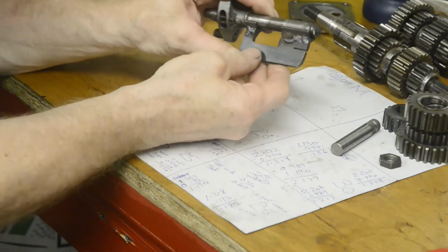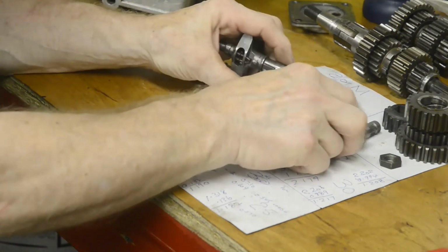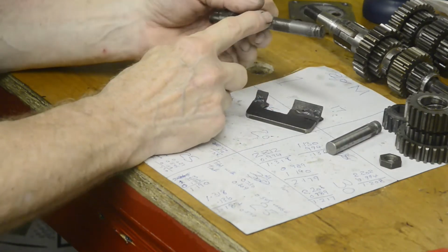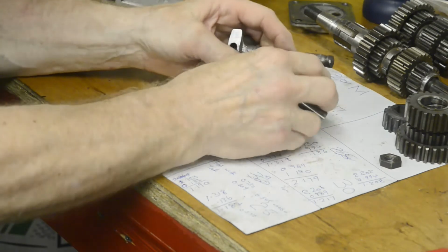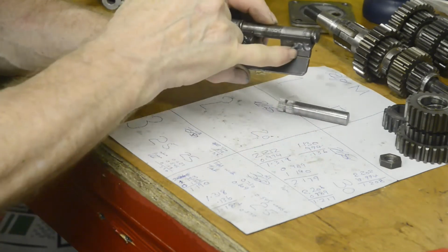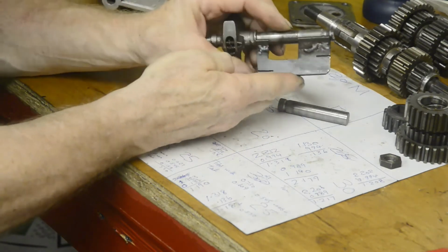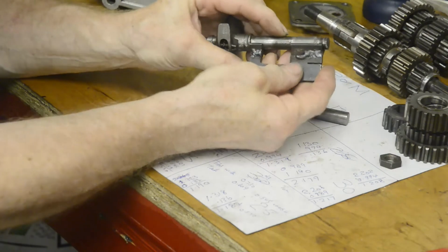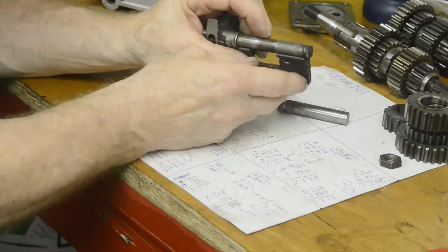And what we do is, when we've cut this in 2, we put a nice V on that end, we cut this, put a V on that end, and then they go in there, just simply with a Jubilee clip, or a hose clip as it's called here. We fasten the 2 halves in, and there's enough space to be able to get in and weld it.